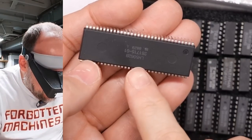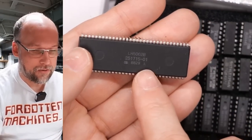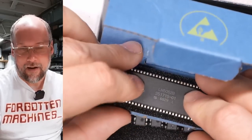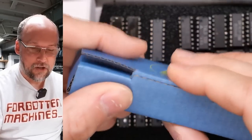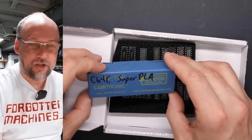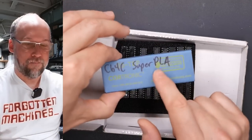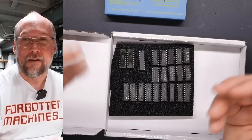These PLAs are made by third parties. By the time the 64C came out, Commodore had third parties making their PLAs and integrated a bunch of stuff into this high-density, high-pin-count PLA — so it's much more reliable than those original ones which were super unreliable. Not to mention pretty much all the chips on the 64C were much more reliable. If you're going to buy a 64 and don't need a bread bin, get a 64C — the later short-board versions are much more likely to work and stay working. Basically the only thing that goes wrong on those is the RAM.